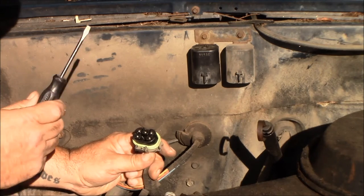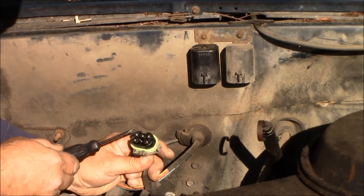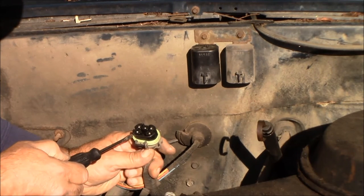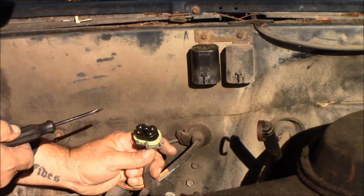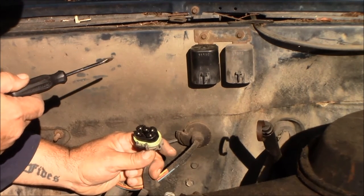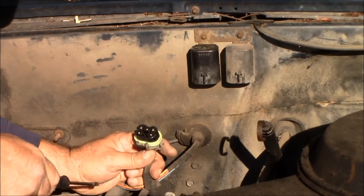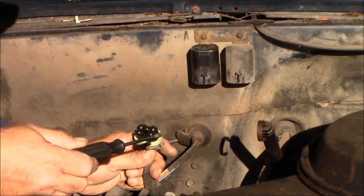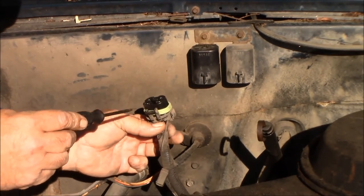When you start cranking, the ECM again delivers power to the switch side of the relay, closes the switch again, and sends battery voltage down to the fuel pump to run it while you're cranking. Because I had a long crank time I knew the fuel pump worked. What I didn't know was: is it the relay not closing and completing the circuit, or is the signal from the ECM bad? A bad ECM signal doesn't necessarily mean a bad ECM - it could be a bad wire coming in, the ignition switch not sending the signal to the ECM, or a bad wire somewhere.